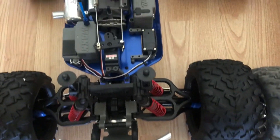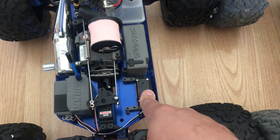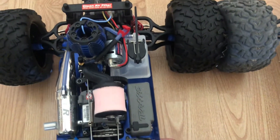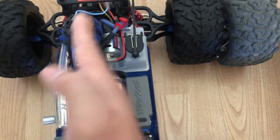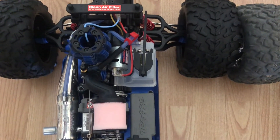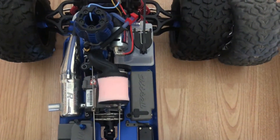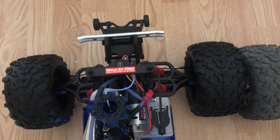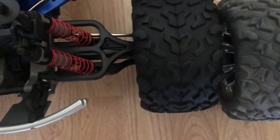The layouts are different on both trucks. Going front to rear on the T-Maxx: this is the servo that controls throttle and brake, and this is the steering servo which goes underneath. The engine is not quite in the center but very close, and it's upright — I do like that. The tune pipe is off to the side; I wish it was toward the rear, but the exhaust does exit the body, so it's not contained inside. You also get dual dampers per side, two arms per corner.